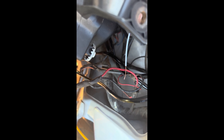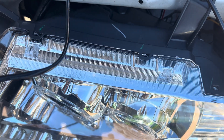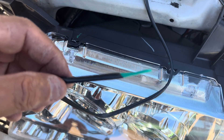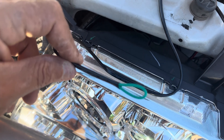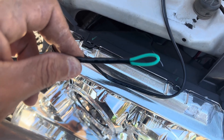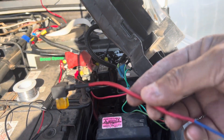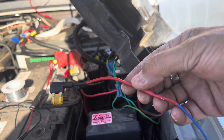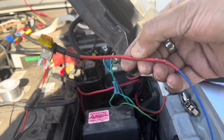This white wire connects into your headlights — in my case I did it to the parkers, so just tap that one in there. The module I bought also had a green wire which goes to a speaker, but I'm not a disco freak so I just discarded that wire. For your main power wire, you want to use one of these fuse taps and run it to an accessory fuse.